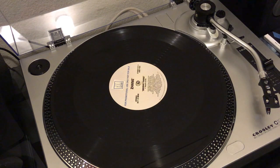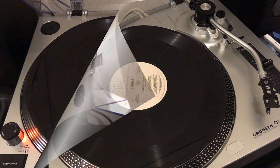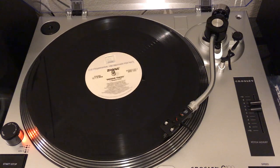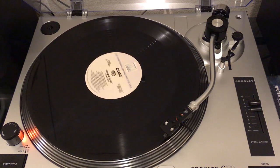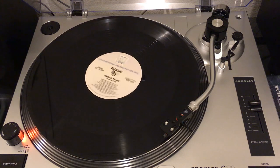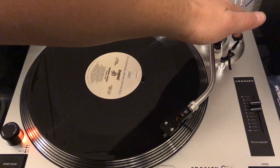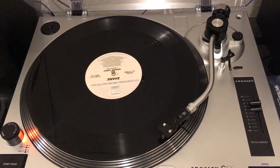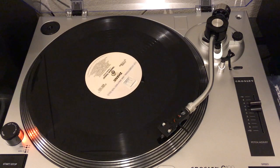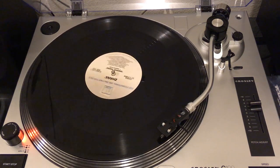So I am going to rewire the cartridges — and I say cartridges because I'm also doing this on the other turntable as well. Be lucky you don't have to sit through that part of it, because I will be right back. Okay guys, that did it. It's actually — I had forgotten this head shell assembly comes off, so it's actually pretty easy to do. I didn't have to worry about realigning the cartridge or anything. And it definitely is the case: the wiring needs to match and stay with the cartridge, not the turntable. Totally clean — there's no rumble. It's great. That sounds a lot better, the phase is correct, and everything is the way it's supposed to be. We got it squared away.